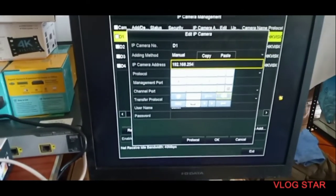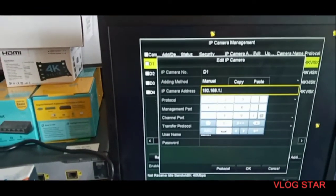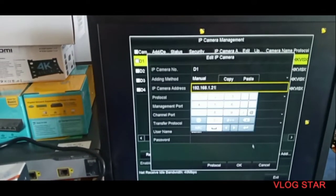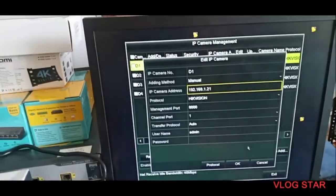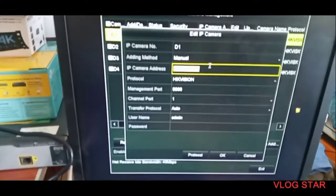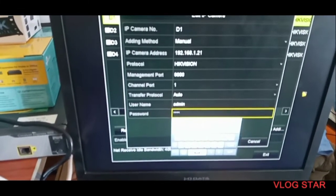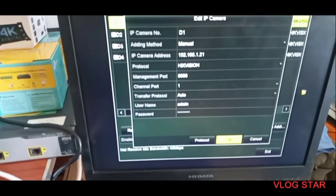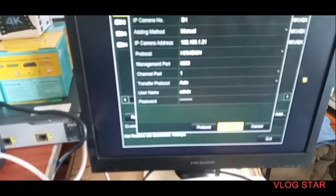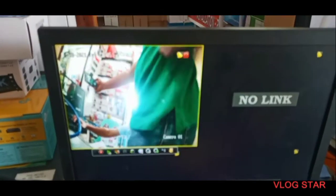The default IP address of the camera was 192.168.1.64, but we have now changed it to 192.168.1.21. We will input that new IP address manually, along with the password we created earlier for the IP camera, then click OK. That's very easy and very simple.